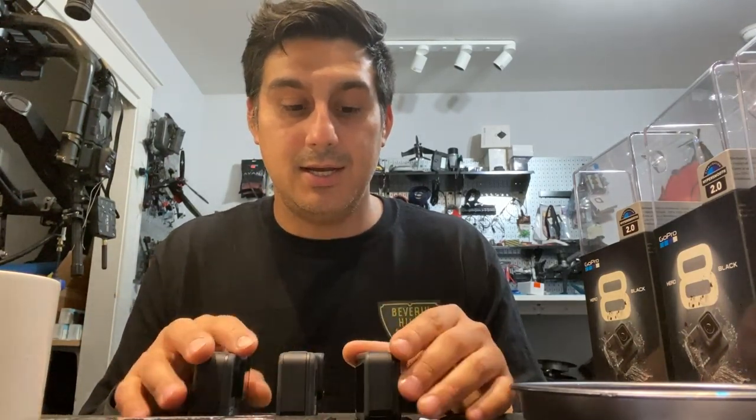So I have updated all these GoPros, tested them all, reviewed footage, and know that they're working. I updated the firmware to either the firmware that you want or to the newest firmware. In this case, with the Hero 8, where we're all about the highest bit depth and bit rate and quality, I updated it to the newest firmware that they have, which also now includes the media mod if you need an output on it, which is kind of cool.